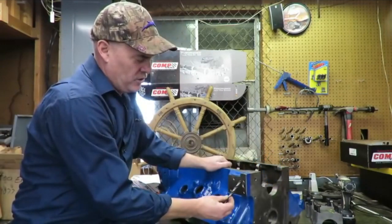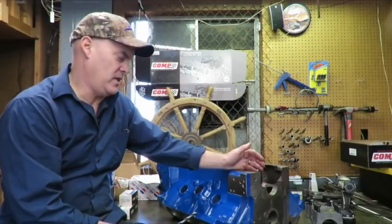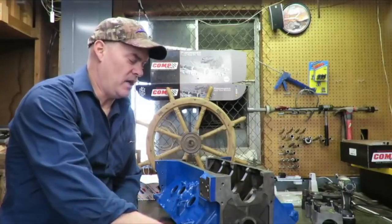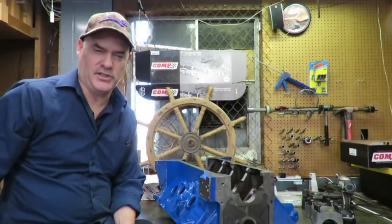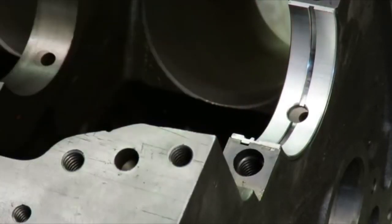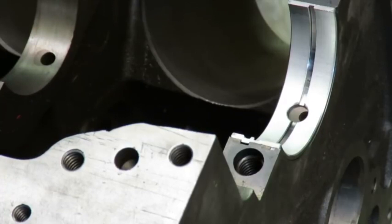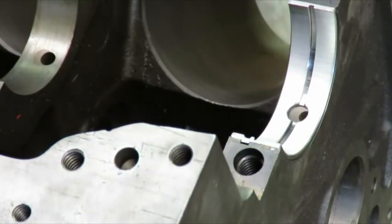You can't open it up too much — you can't go all the way through because there's a 90-degree turn here — so we're opening up the top side of this hole. Then you take a very fine Dremel and port it, and drill up here with your 7/16th drill bit. This is a really common mod for the FE — every FE I've ever done I've done this to. This engine isn't going to see that kind of RPM; the camshaft going in is pretty mild — a hydraulic roller — basically building a truck engine for lots of torque and performance.